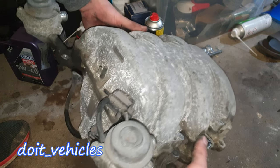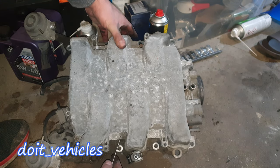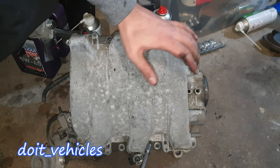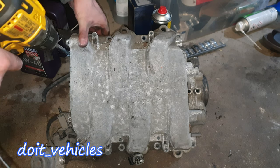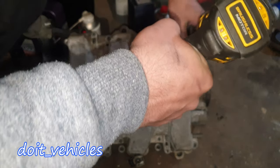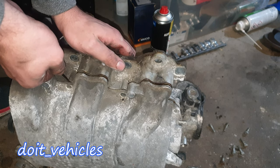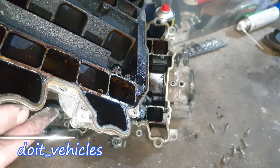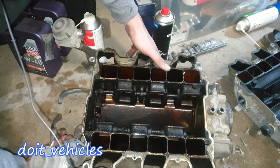If you want to get access to the intake manifold runners, we need to take out this cover of the intake manifold. We've got a bunch of bolts around here — you're gonna need the T30. Let's have a closer look. I have no choice but to pry it out like this, and we've got a bunch of gunk in here. But surprisingly, these flaps work, which is great.